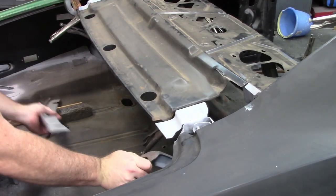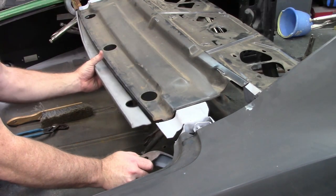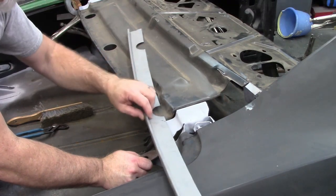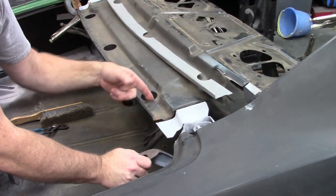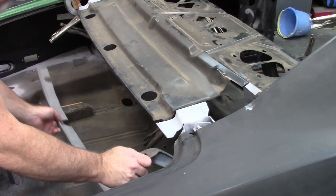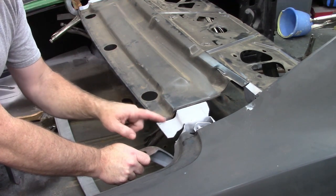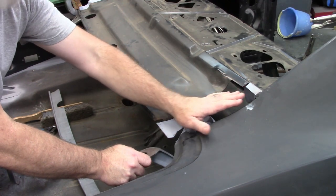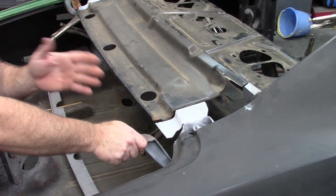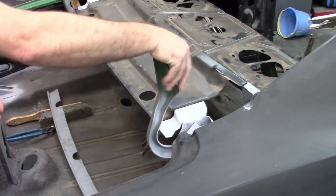This piece I mentioned earlier — if I were to just replace this as if it rusted out, it goes right here. I did that on the other Camaro; that's why it has those cutouts to line up with existing holes. But I don't need that piece — I need the other pieces. The rain gutter is supposed to go underneath this, on top of this, and underneath this. Then the filler panel sits on top and it all interacts together. So I'm a little hesitant to move forward without having those pieces to sandwich in.